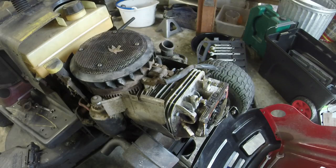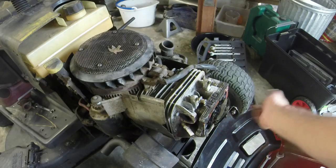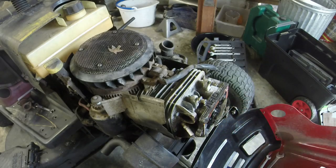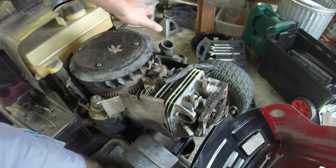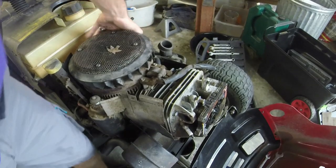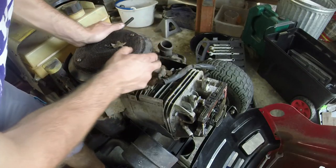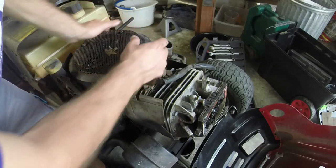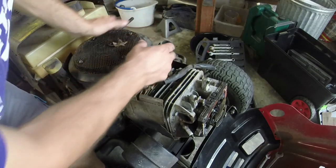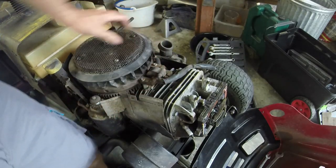All right, y'all. I don't know if the prognosis is good on this. Reason I'm saying is I've got the valve back on. And check out, so we got the intake on the bottom. Intake's working great. But check out the exhaust valve. So the intake moved that far. If you can see the exhaust, look how little it's moving as opposed to the intake. So that makes me think that this thing's got a bad camshaft.